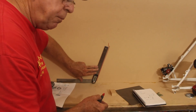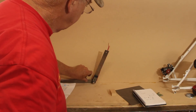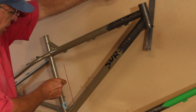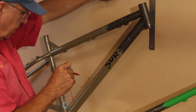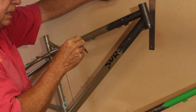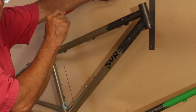Just like we did on the rear frame, we're going to mark the angle on the middle frame. I've aligned the seat tube to the original line that I drew, which is the factory spec of that angle. That ensures that the rider on this frame is in the proper position. It also makes sure that the crank is at the right height in relation to the ground, because this angle directly affects the rear axle height.